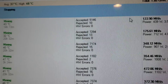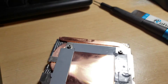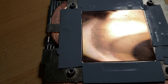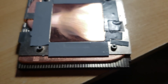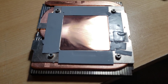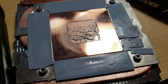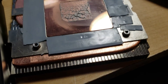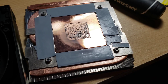Okay, that was a fail. We're going to take it back apart and try some 0.5mm. Trying the 0.5s — I did not clean that off, that didn't make any contact. The 1mm was too thick, going for the 0.5. Trying to use some scraps up. I wasted a whole pack of the 1mm. Let's see if this works. We have contact, guys — awesome. I can feel the thermal pads sticking a little bit, see little impressions. We're making contact. Let's get some hashes on this thing and see what happens.